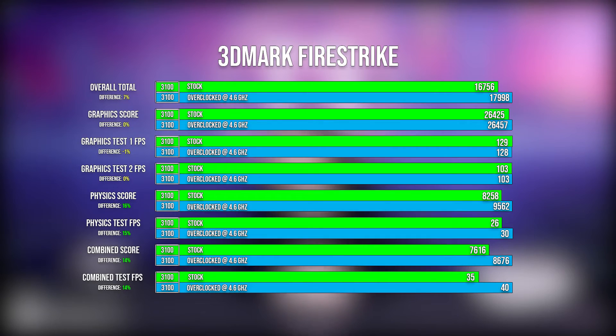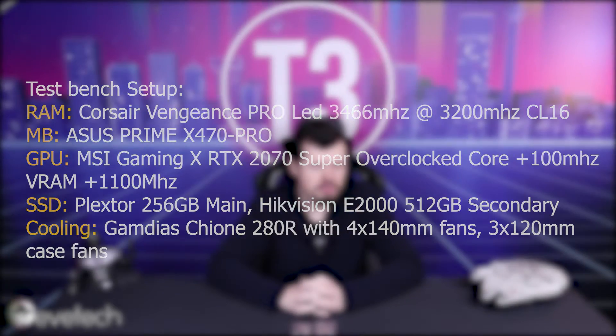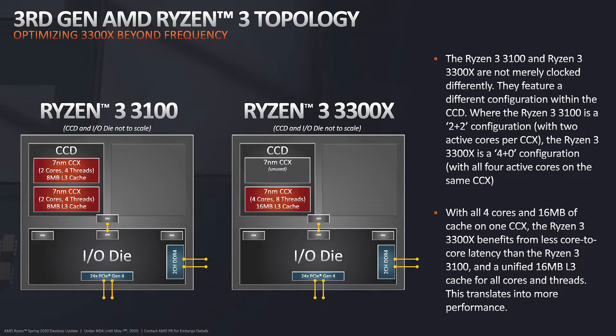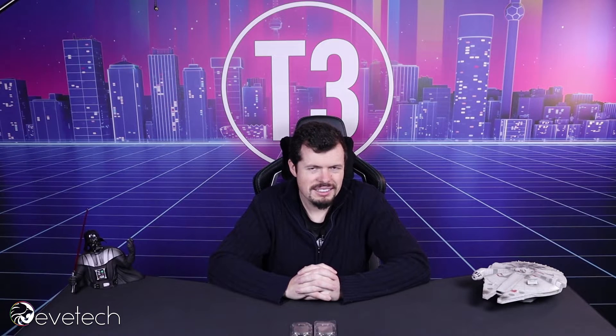I did have it underneath my Shion 280R, so it was cooled more than what you'd get out of the box. But based on those test results, I only managed to hit 68 degrees while trying to overclock it as hard as I could — and that was a 4.6GHz all-core on the 3300X. The 3100 also did a really good job. There's just a physical difference inside the cores which does make the 3300X quite a lot more responsive, especially with single-core tasks. It's got less channeling happening inside the processor — one communication lane instead of being split between two and flopping back and forth — just straight up down-the-line performance. And they've done this all incredibly, as I said, at $120.